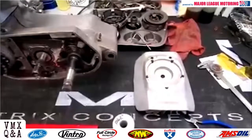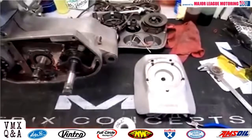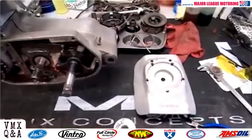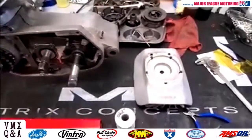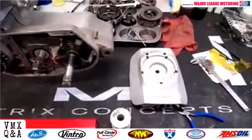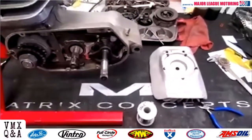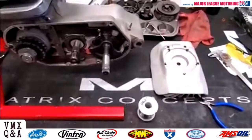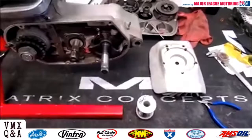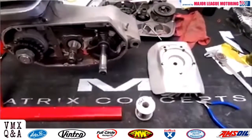At the top end, and as you go from 60 thousandths, which is probably safe to use for pump gas, towards the 40 thousandths, you're going to have to start using race fuel. And for guys that use race fuel, I like to set them up at 50 thousandths on the big bore Mako. So everything should be cleaned up, the head, the piston dome.